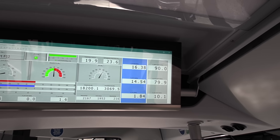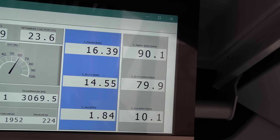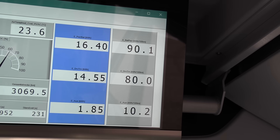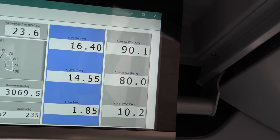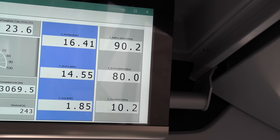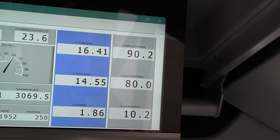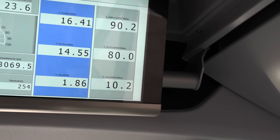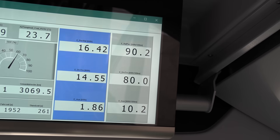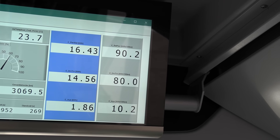Back at the factory — the consumption reading is 90.1 kWh. It was 89.9 when we arrived but the bus is using some HVAC while stationary. The lowest number is the energy going to auxiliaries — HVAC — and the drivetrain is 80. In winter that auxiliary portion will be way higher, maybe half and half, because of opening doors and more heating. That's a 50-50 split in winter conditions.